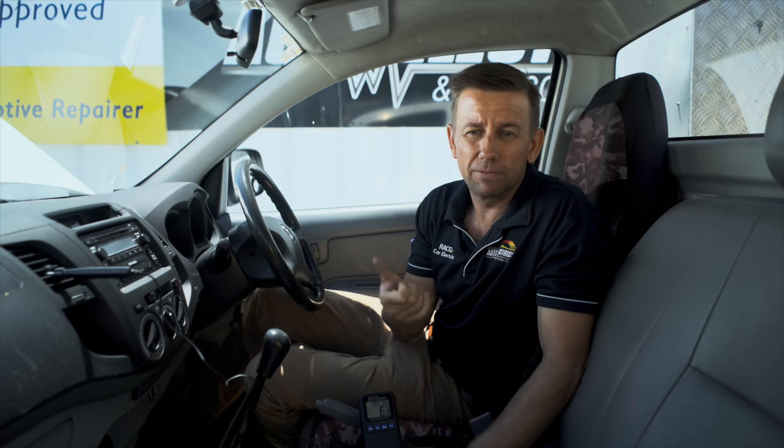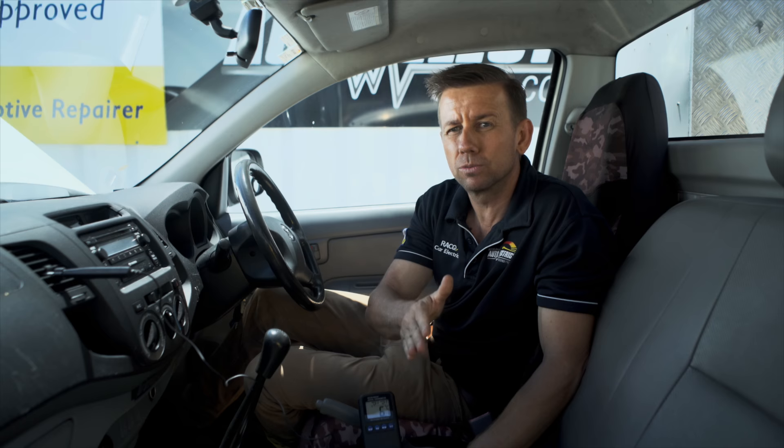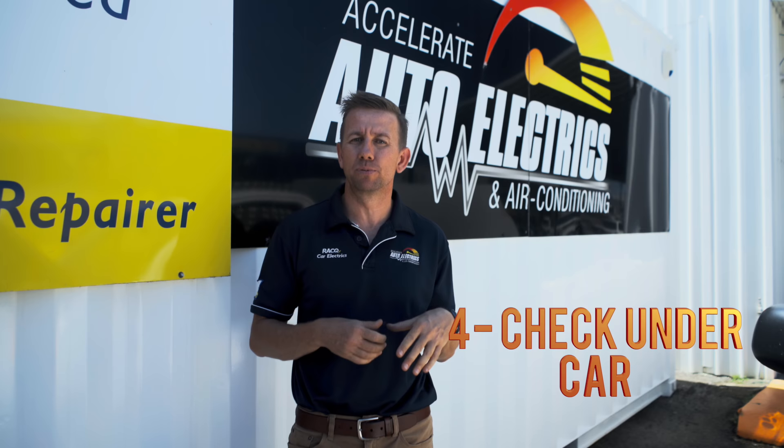If you see a temperature going below five degrees, that is a sign that something's wrong. It's either going to be a faulty thermostat or thermistor, or more commonly a blocked cabin filter. A blocked cabin filter will restrict the airflow to the vent, allowing the evaporator to get too cold and freeze up into a block of ice. If you're quite handy yourself, you can get to the cabin filter and check it and replace it yourself.